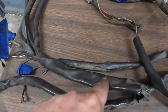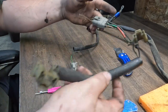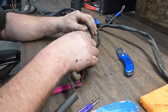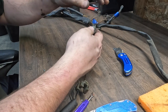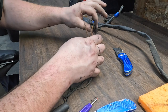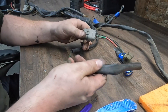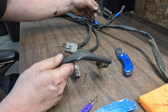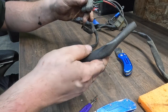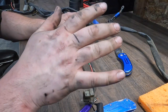First is going to be getting this conduit off of there. I have this little headlight sub-harness which goes to one of the sides, and this is pretty apparently not correct. At least we can see the colors and what goes where, so that's going to be easy enough to fix. I know I'm going to want to keep the headlights as well as this marker light over here, which is pretty gross. There is some stuff I'm going to get rid of, which we'll have to look through the diagrams later to figure out what's what.